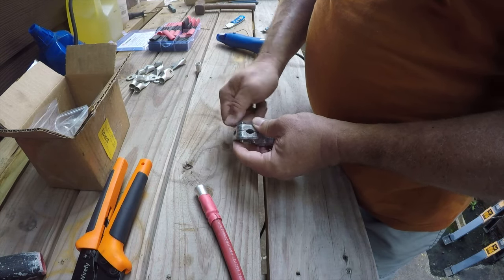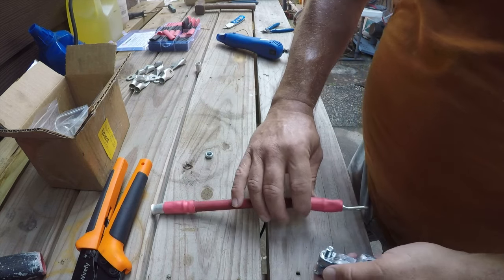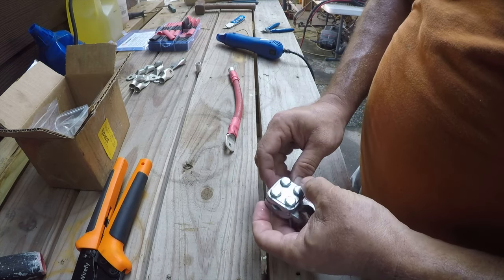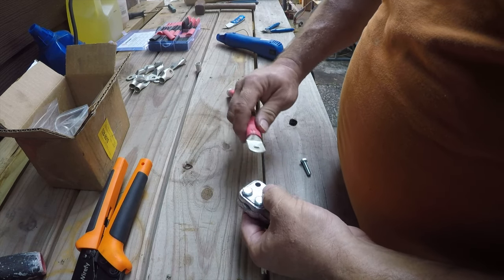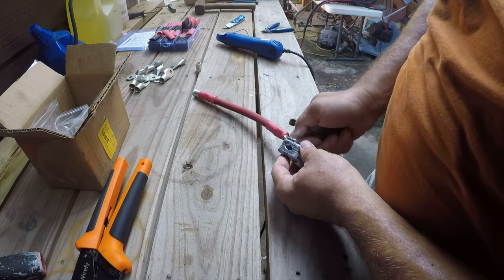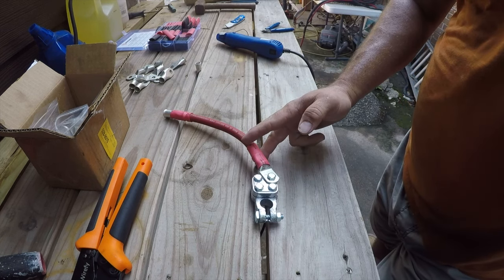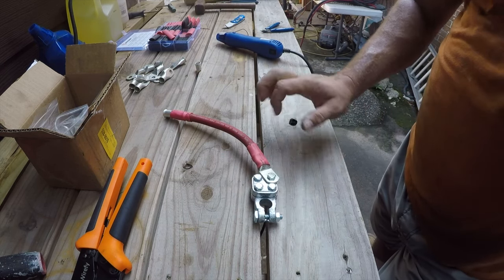And I think we said we were going to come in on the side terminal, so we can deal with that later. Well, actually, we're not going to come in through there, so we are going to come in through the top terminal. And honestly, it's just fine. We only needed probably this much cable, so this gives the new owner some flexibility to change. He's probably going to have to cut this off and re-terminate it in order to come in with a larger battery connection. But this will work for what I'm doing.